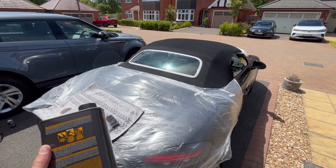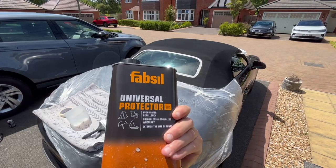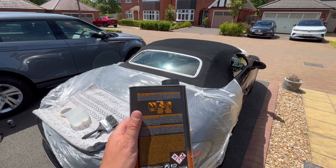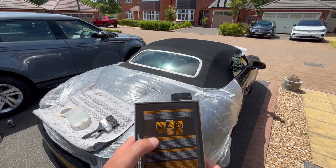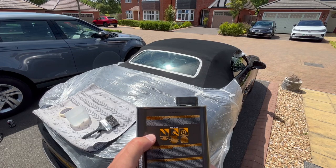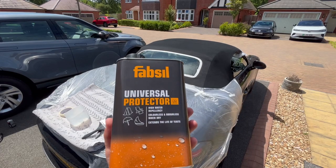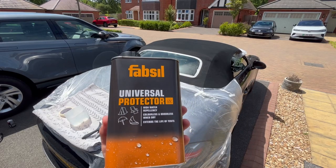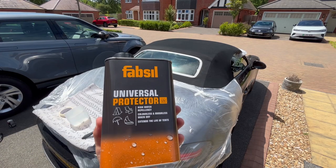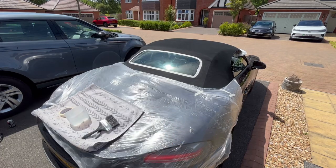While my neighbour plays on his silent drum kit, I'm going to apply this FabSeal. I'm going to pop it in that pot and use dry, brand new paintbrushes as it recommends on the tin. Basically you apply it on, then use a cloth just to wipe off any excess, and it's a six-hour drying time. I will do a before and after of this roof to hopefully see if it does change the colour. Now it's painting time - let's burn through this FabSeal waterproof roof.